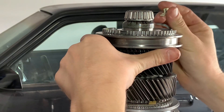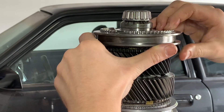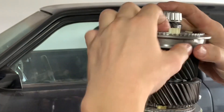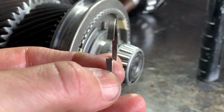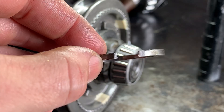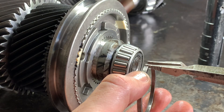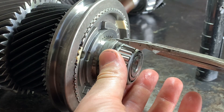Snap in our tabs, and then our snap ring for the front to hold on that slider. A quick tip on these snap rings: they are directional. The side that's facing down right now — the narrow end — will face outward, because when you put your snap ring pliers in and expand them, it will give it something to grip. If you have to take this snap ring off and you put it on backwards, it's going to give you a really hard time.